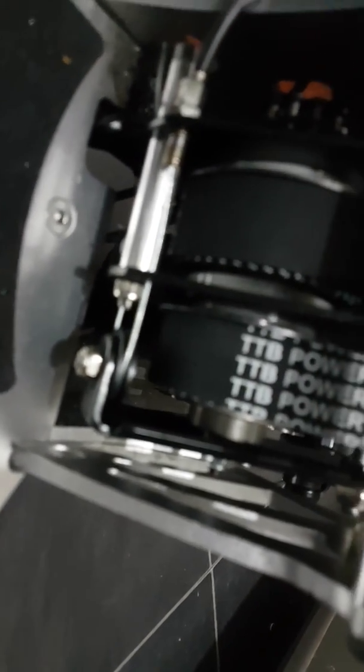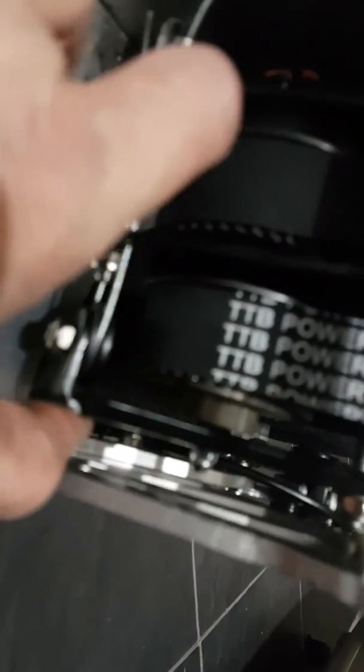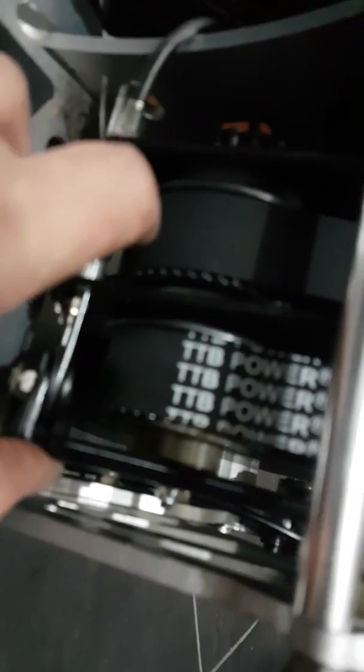See that movement? That's first gear, and then I'll select second and it pushes that in second, and this is now tight, there's no movement, no play in this whatsoever. And in first gear, now we've got play. So you really want to go for no play whatsoever, so you've got to select second gear. It's all adjusted, like I said, it comes through here with plenty of adjustment for the future. It goes around underneath through the location pin.